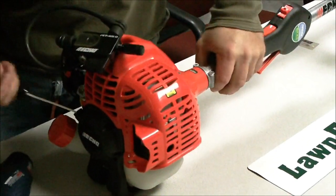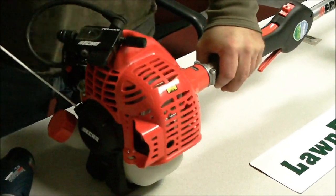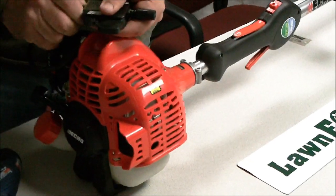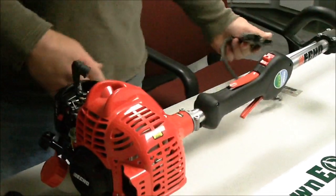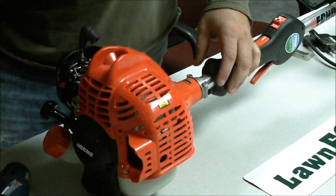Make sure you've got a good blue spark. You need to get in an area that's not real bright where you can see it. Right now this one's showing good spark, but I'm going to go ahead and show you how to tear down and check the ignition coil in case you're not getting any spark.